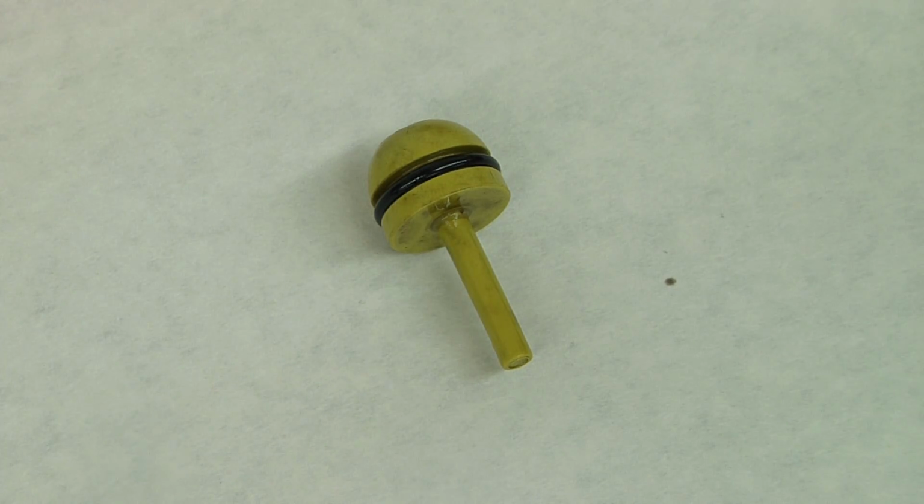Now, when I dropped the transmission pan, I found this little yellow plunger inside of it, and there's no apparent location for where it goes, so I did a little research online and found out that Ford uses the plug in the dipstick hole during the manufacturing process before the dipstick gets installed. And when the dipstick tube is installed into the transmission pan, it pops that plunger off and it sits in the bottom of the pan.